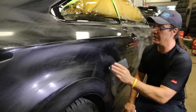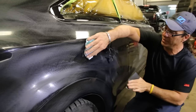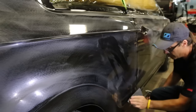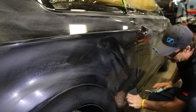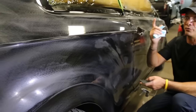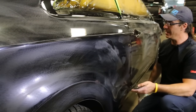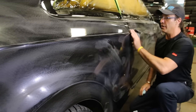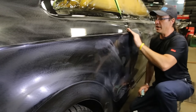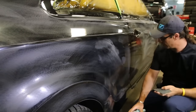You don't need a block for these small little pieces of dirt. I've seen guys take blocks and it's just such a waste of time. Doing this stuff when you've got so many cars in a day, you don't have time to put a piece of tape on all the edges. The only edges you really need to tape are the panels you didn't paint, because these days there's not enough clear on these cars to do any sort of repairs, let alone wet sanding and polishing and burning through an edge with the buffer.